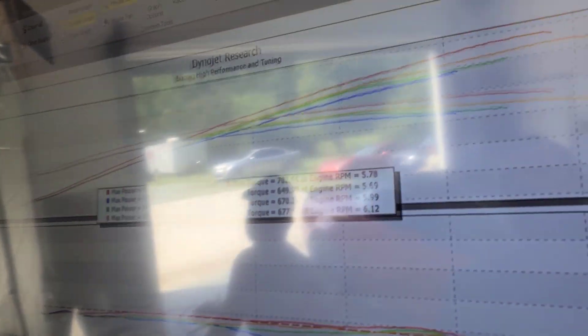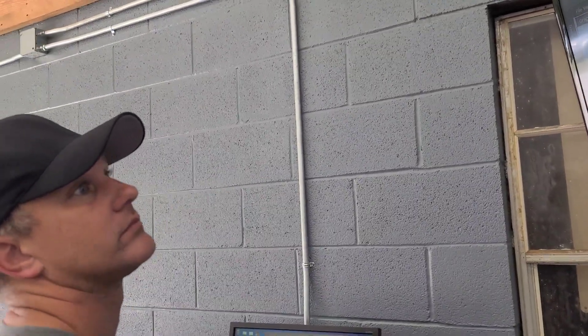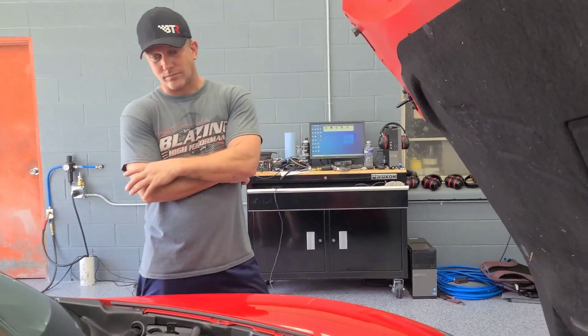The one that's going to be more accurate to your fueling will be this orange line. We don't try to hide anything. The last one we cooled it down — got a little lean up top. But this is what he's going home with at least this much, probably in between the two. I kept the timing because it was super safe and it didn't knock. This was pull after pull after pull with no cool-down. So if you're driving on the street, you probably see that. If you go to the track, pop the hood, cool it off, you probably see it closer. He put some race gas in the last one to try to see if it was worth anything. The filter on there was clogged — it was really dirty — so he didn't want that to go back on. He's going to end up with a race screen, like a turbo guard, so that'll put him over 800 all the time.